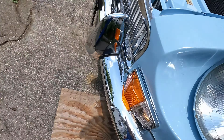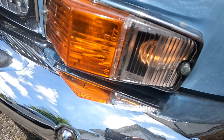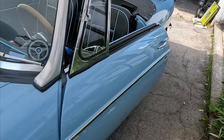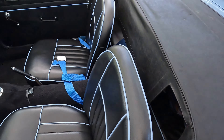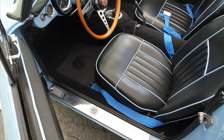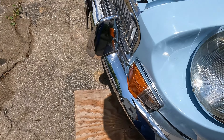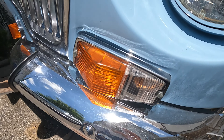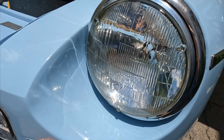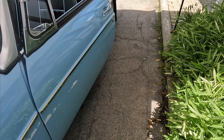The headlight switch has three positions: off, running lights, and headlights. I put the switch in its second position and the running lights came on, but not the amber portion. In the third position the headlights should come on, but they don't. When I engage the high beams the headlights come on, but they don't seem to be as bright as they should. I figured it wasn't the bulbs themselves since both headlamps are behaving the same way.